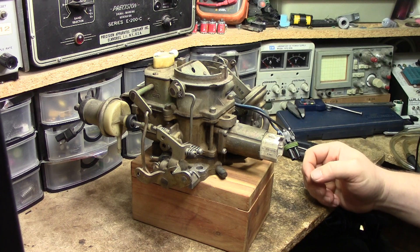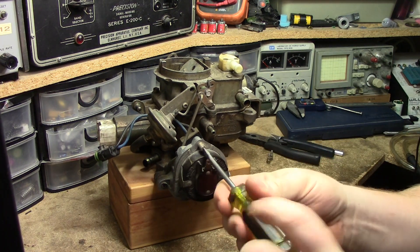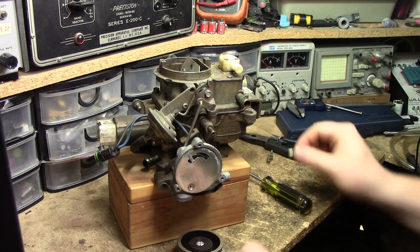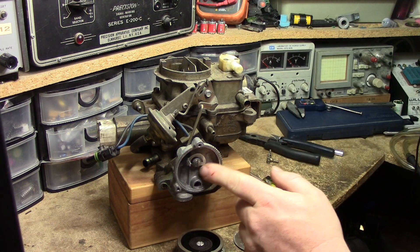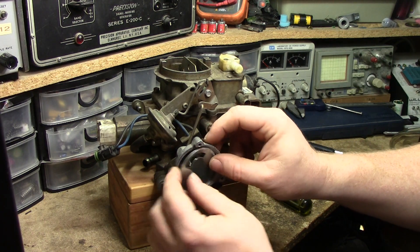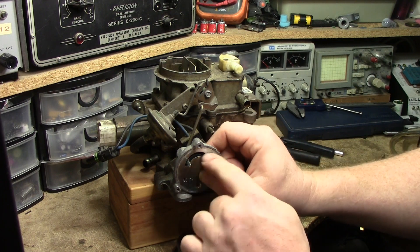But let's say that you're an individual like me where I don't believe that is the solution. There are many questions about this, and AMC's own TSM is kind of mysterious about this. The first thing we want to do is make sure that our entire choke linkage is clean or has been cleaned and is ready to go. In the full open position, the lever inside — the half moon — is facing upwards. When we put our plate on, we have this hole here, which is centering on the hole here for one of the screws that holds the housing to the carburetor.